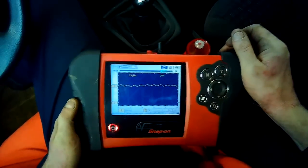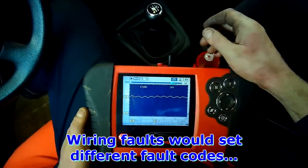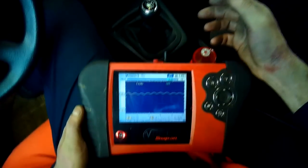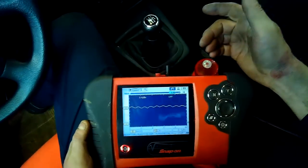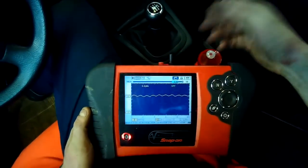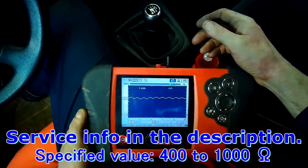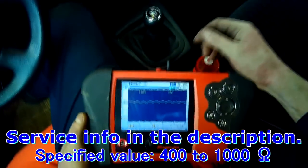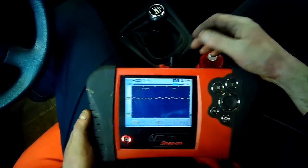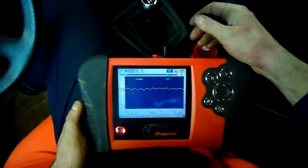I'm going to put a crank sensor in this one. I know I'm not going to do any testing of this crank sensor, but I'm going to show you guys the sensor — because again, it's working fine, and 99% of the time it's a crank sensor fault. I have yet to see wiring issues or anything like that. Intermittent hard starting, especially or stalling when the vehicle warms up — when the engine gets hot and stalls out — that's a usual sign or symptom of a bad crank sensor. Or driving to the shopping mall, engine is warm, you shut it off, come back half an hour later and it cranks and cranks and cranks — another telltale sign the crank sensor is no good. There are resistance values I'll put in the video that you can check; most likely it's going to be open circuit.